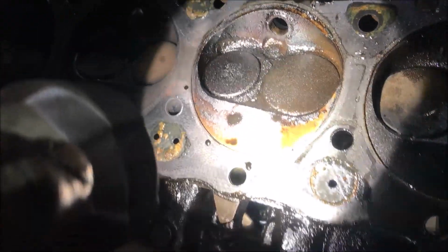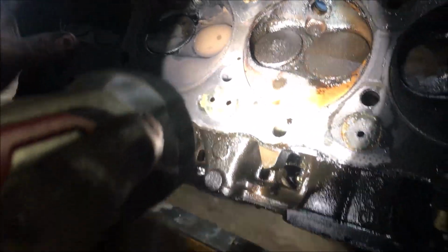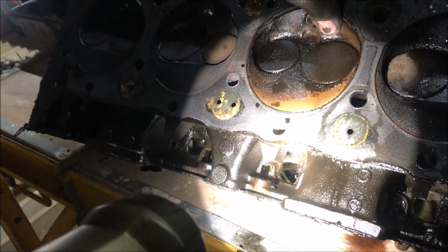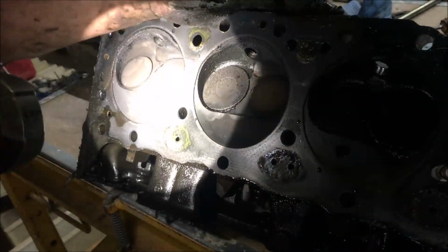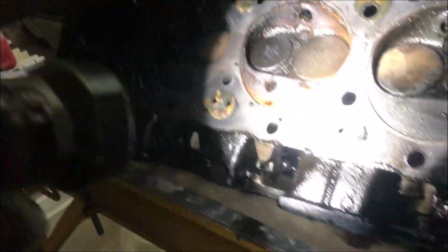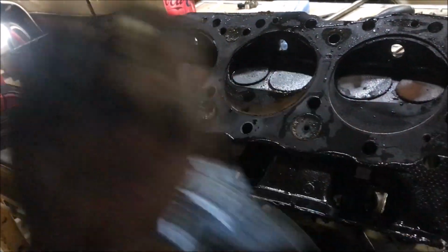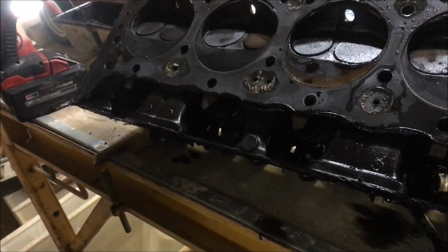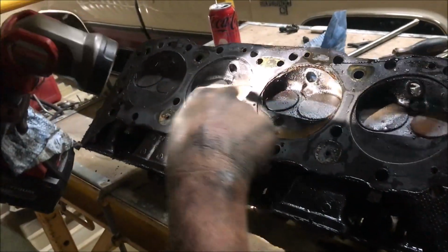All right, cylinder one was fine. This is the one that wasn't firing, that one there. Valve looks fine. It just wasn't firing because that push rod wasn't doing nothing. And that head gasket looks good too. Well, it's blown right there. See that? Them two were swapping cylinders, so you had two dead cylinders. That would make sense. I've had vehicles before with a dead cylinder, and they'll still go. It probably had one dead one for a long time, and then once I lost the second one, I started noticing it. Yeah, you blew in between compression.